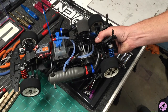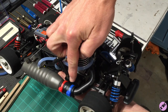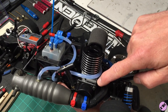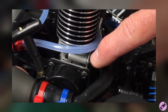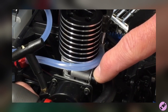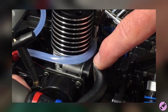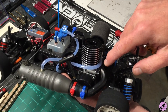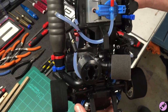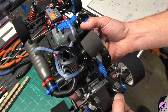I had to make one curious improvement or adjustment to make sure that we could clear this pull start, and I had to use a spacer of sorts. What I have here is a normal gasket, then an aluminum Dynamite gasket, which is, I don't know, about 1 mil, 1.5 mil thick, and then another standard exhaust gasket going to the header flange. And that should provide enough clearance for the header on the pull start, and still should give a good seal there.